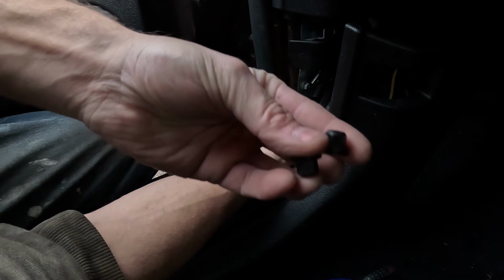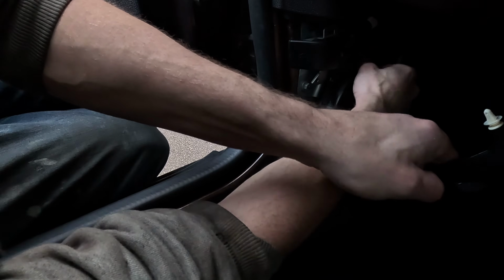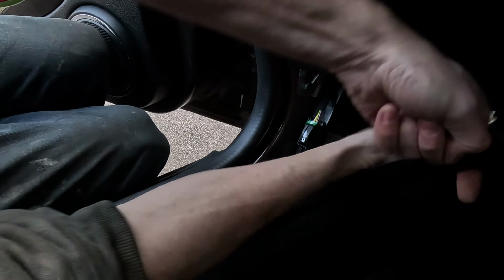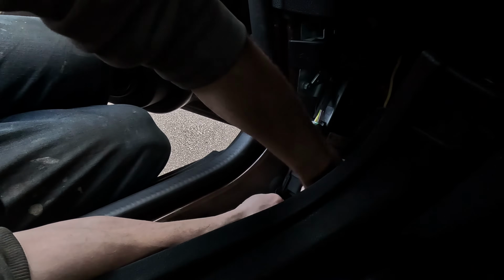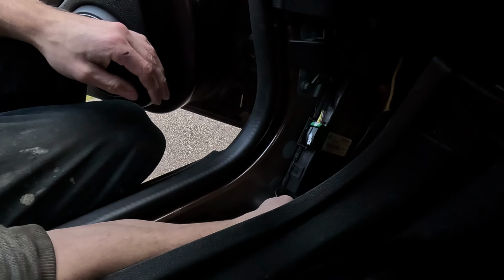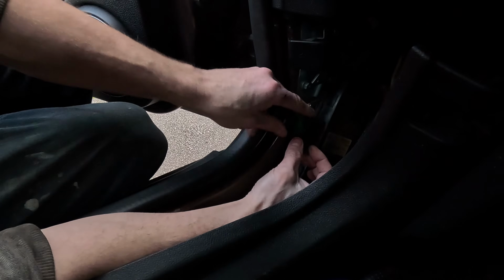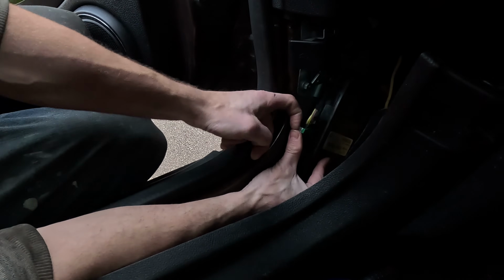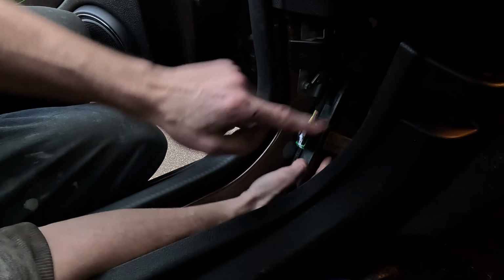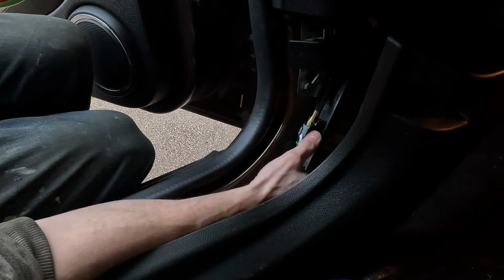and then we can loosely put these nuts on. So I'm just finger tightening them at the moment because my priority is to get the plugs put back in. So put that one on the bottom. So again, it's a bit awkward to get onto. Then we'll put the last one in, last clip. So push in till it won't go no further, and then just slowly push that down like that. You can see the interior lights just come on, and we have got working windows, I believe.